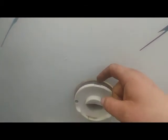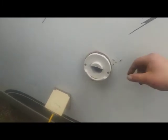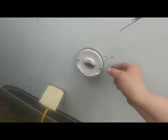But also when you do wash the van, try not to let all the water get down in through this pipe. I do recommend sticking a piece of metal or something over it. We did have a few brand spanking new vans last year that had water going in through. Really? Yeah, brand new ones. And the cure for that was to stick some stainless steel over the top. Which I can get made for you, no problem at all. And that will stop any water getting in through the boiler.